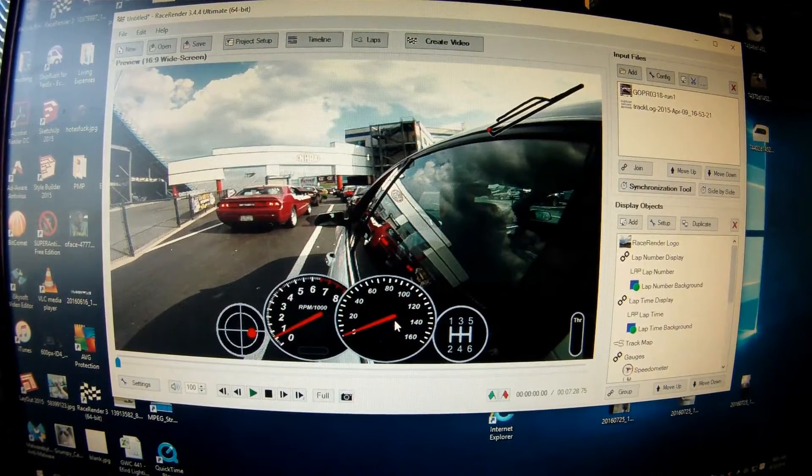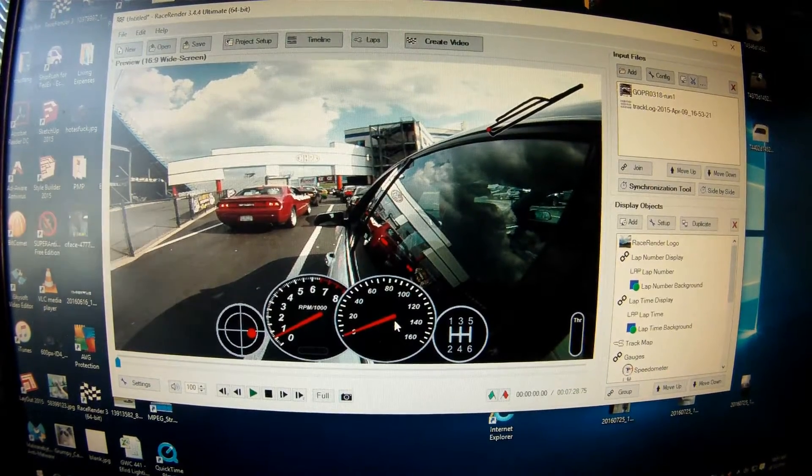I've seen a competing product that some autocross guys are getting into and that application was over $200 — and I'm not even sure that includes the hardware. Basically it does a similar thing but made slightly easier, and for $200 I think that's a total ripoff because I've got less than $50 in this setup. To review: you need the Bluetooth OBD2 adapter at about $8, the Torque Pro application at $5 from the Play Store, and Race Render at about $30 — and that's all you really need to add gauges to your GoPro videos.